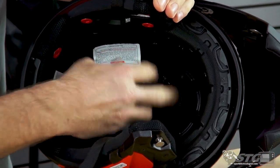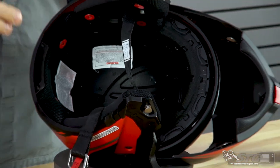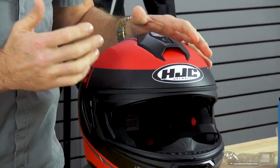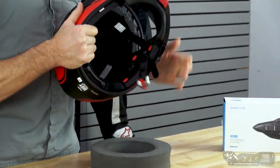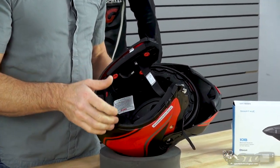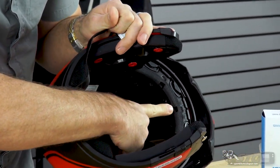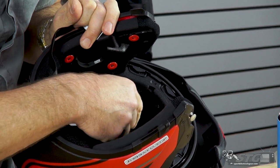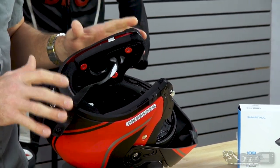Looking inside the helmet now, you can see the channeling they've built into the EPS — two exhaust vents back here, two intake vents here. Is this a massively ventilated helmet? No. Anytime you have a modular with a drop-down inner shield, you're unable to put ventilation up in the brow area, which does compromise ventilation performance a little bit. That's understood with helmets that offer a drop-down inner screen. With that said, these have proven to be effective — HJC has taken steps to make up for the lack of brow venting. These channels run all the way down so that when air comes in, it can move down in this area as well. Air coming in through the chin area and up onto the shield can come up and get sucked out the back. It's as effective as it can possibly be.